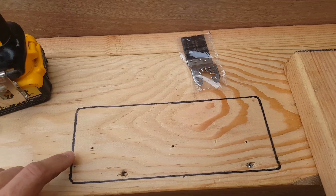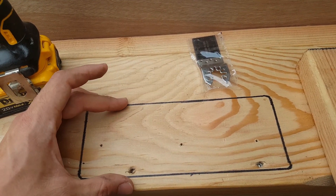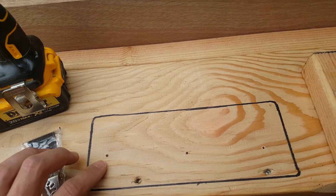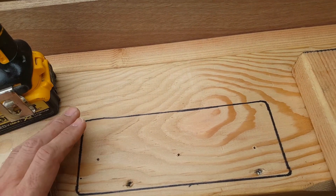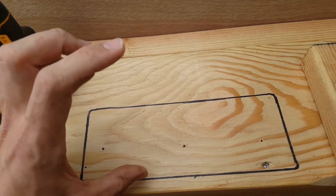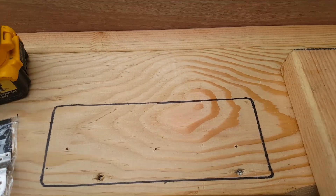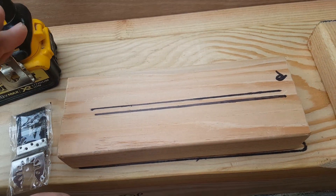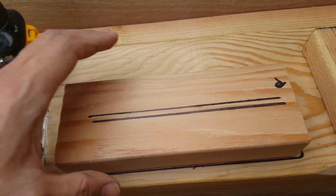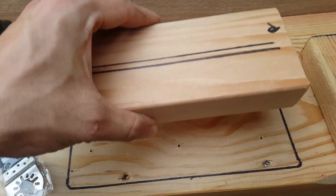Let's take a look at where we're going to put the engine mounts. You'll see I pre-drilled some holes because we're going to flip this thing over in a little bit and mount these. You'll also see I have an oscillating blade. When you're doing your project, if you hadn't taken the time to measure everything perfectly and you're worried that you're not going to hit your engine stand and your engine mounts perfectly and it's going to be off a little bit, you can either grab one of the blocks here or choose not to mount it and just toenail screws in from the sides and glass over it or Kevlar over it. I like to drill from the bottom just so it gives a little more security so the engine can't ride up and down.